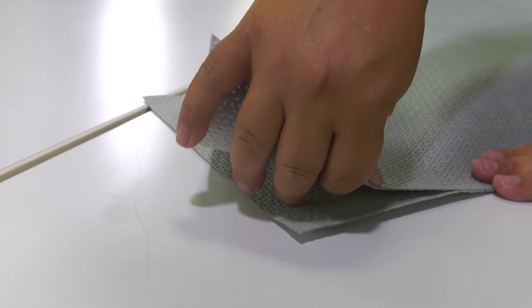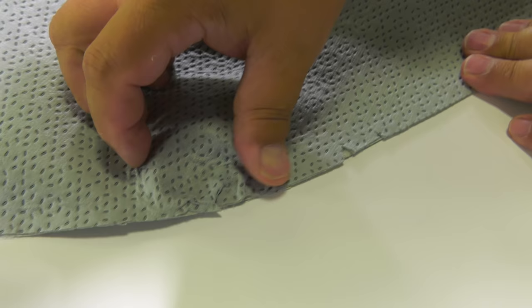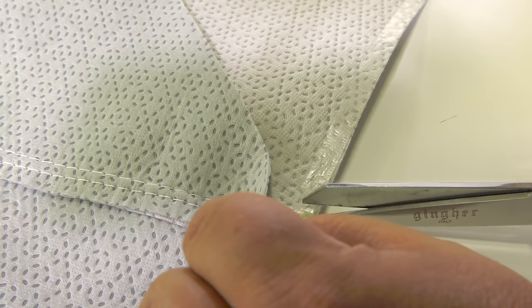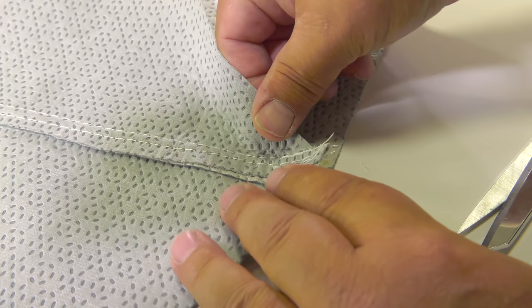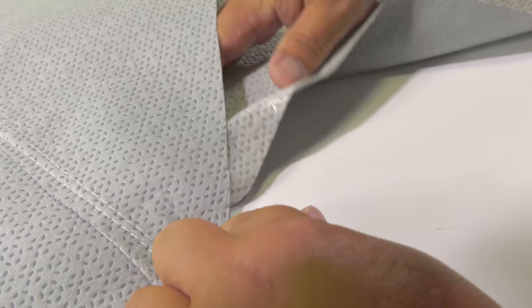When we get to the bottom edge at the front of the motorcycle, notice the panels don't line up perfectly — do not worry, we'll be trimming later. At the peak where the mirror is there's a large transition — we cut notches in the material underneath so it can take the turn and the notches allow the fabric to spread a little there.